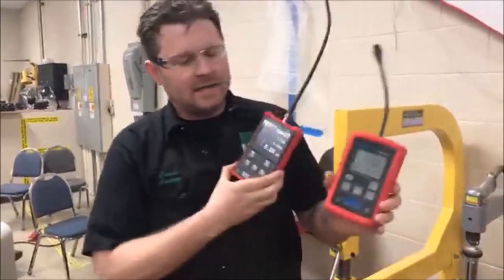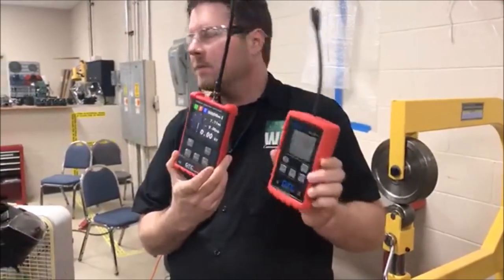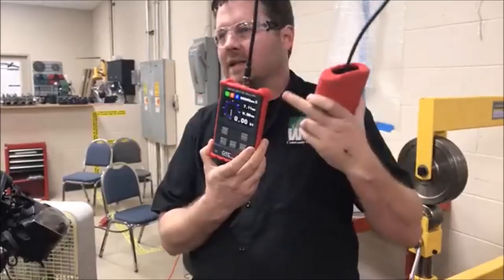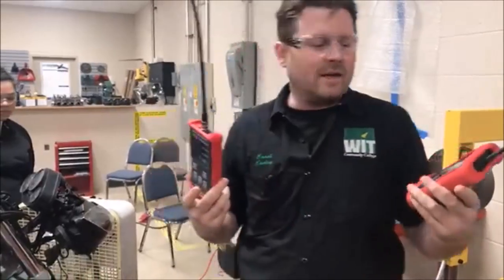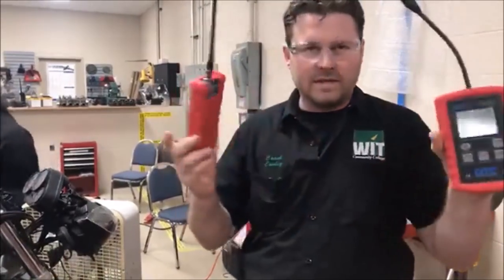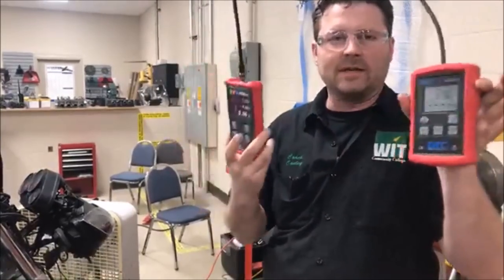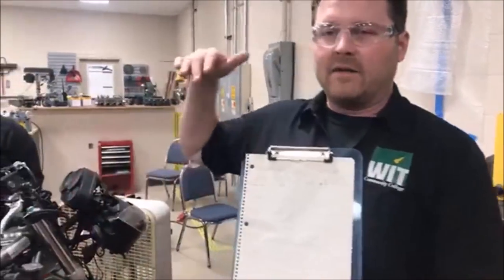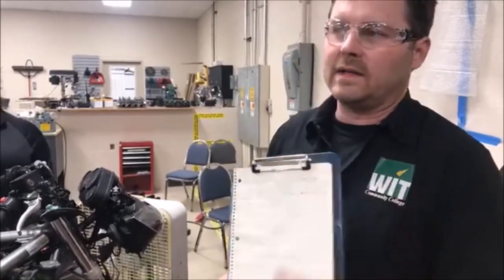The understanding I got is this was the older technology, and when they made the new tool and came up with the most accurate data, I think it was the president of the company — he just simply said this is the ultimate tool, the ultimate data. But they don't dismiss the older one because we don't have a spec we're comparing in a manual. What we're using these tools for is to determine a problem, to be able to see electricity, to see spark. This is a tool you would literally take right to the machine and verify not only that you have spark, but how much spark you have. That would show you weak coils, bad plug wires, bad plug caps — just something wrong with the ignition system.